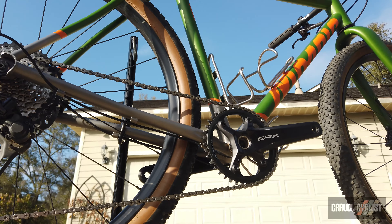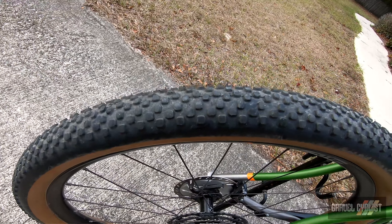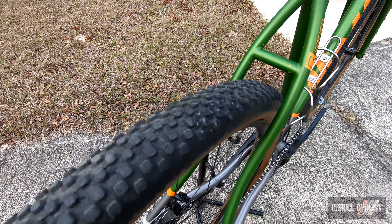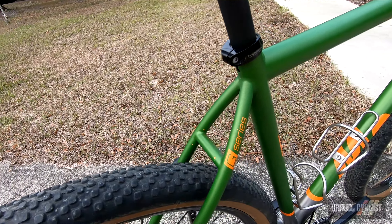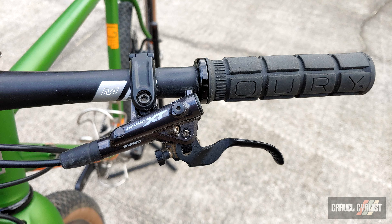The drivetrain is definitely a mountain bike type affair. It is Shimano XT rear derailleur, and this is a 1x bike which features a GRX crankset — an interesting hybrid really. This bike will only work with mountain bike and gravel type groupsets, predominantly due to the wider bottom bracket stance for the cranksets. The chainring is 40 teeth and the cassette is 11 to 42. Not the lowest of gears, and it'll be quite interesting with these sizeable tires because wider tires increase the outer circumference of the wheel, which makes the gear ratio bigger.